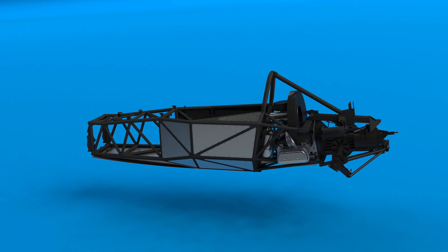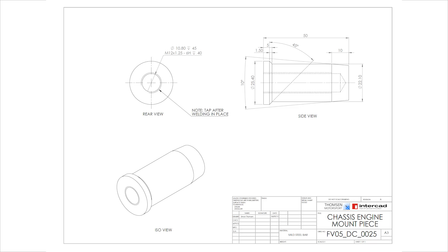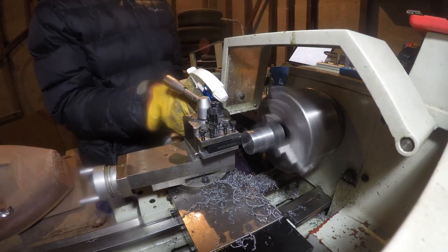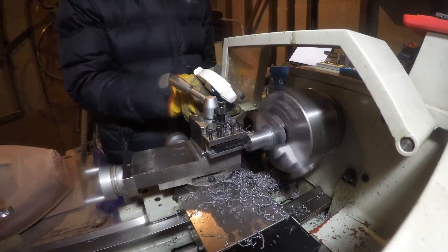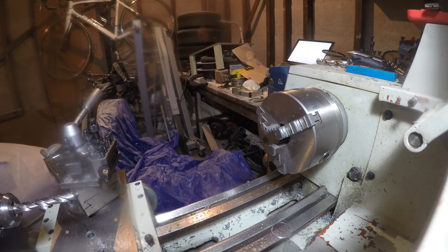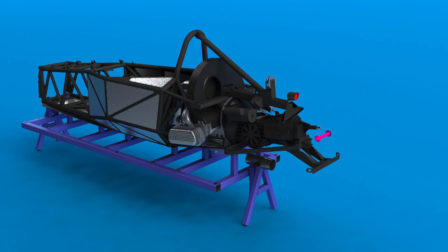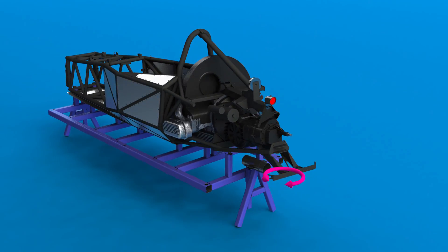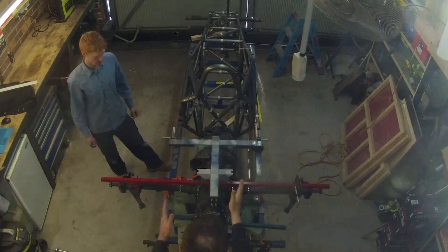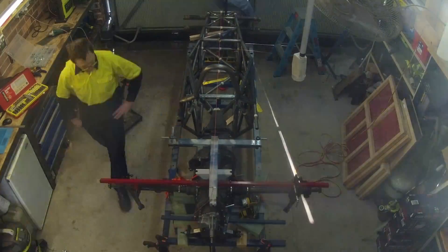Back to the chassis itself. Next we needed to connect the engine and gearbox to the chassis. I had to make two inserts on the lathe for the lower rear mounts — the transmission subframe would bolt onto these. The biggest challenge was actually just getting the position of the engine correct. You start to appreciate how many degrees of freedom there are when you're trying to position something perfectly, and to make it even more difficult there weren't many convenient points on the engine to mount or measure from.